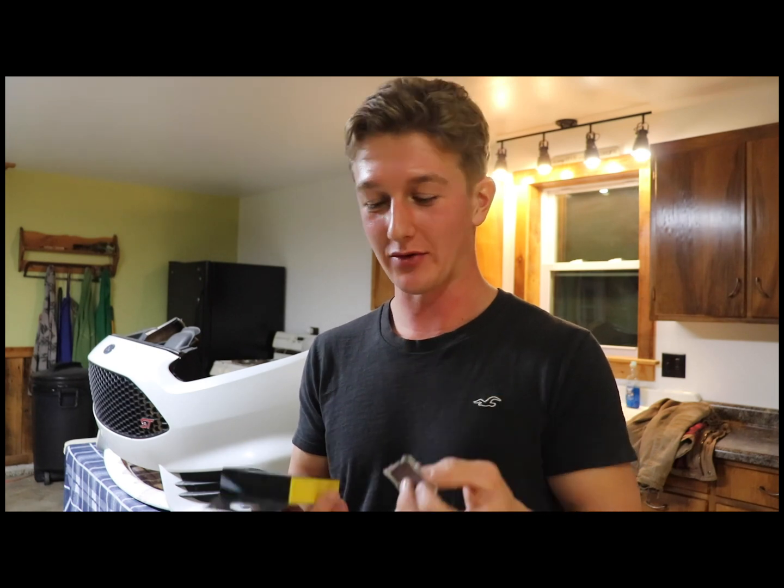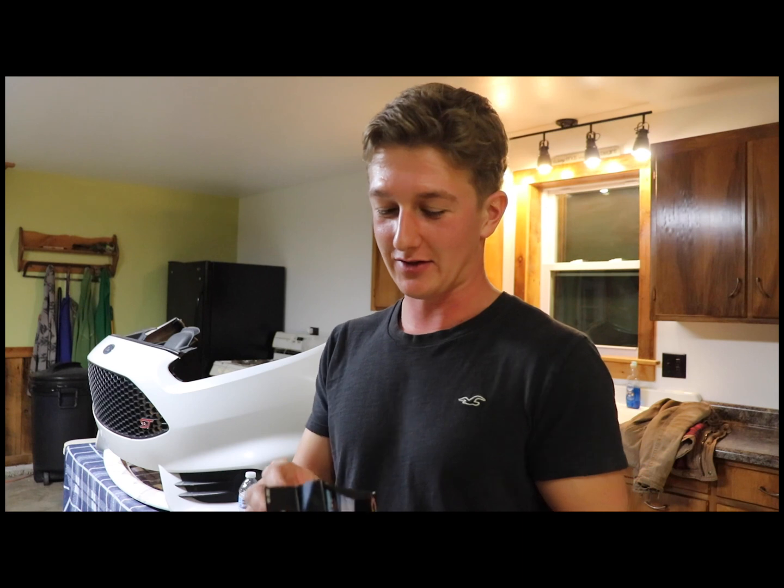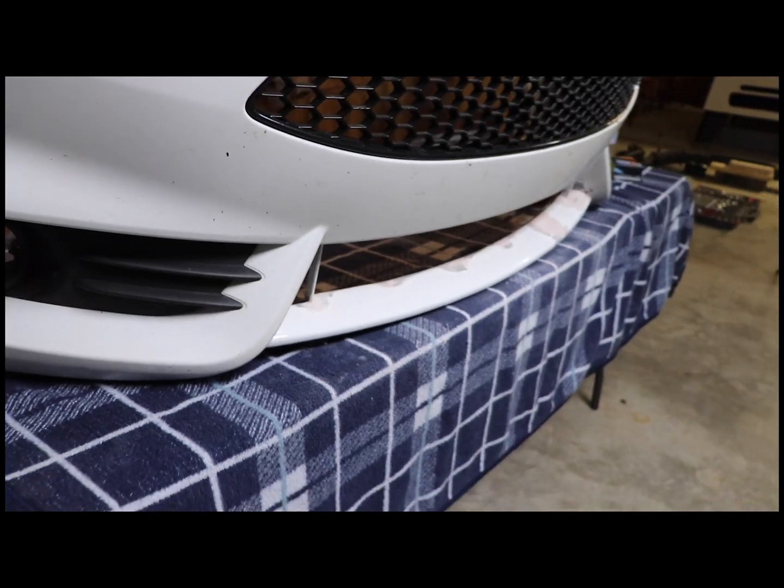This is basically day 3 of working on this thing. It's taking much longer than I thought. But anyway, I did sand it down with some 80 grit sandpaper, and then I have some 320 here to finish it up. I was pretty worried last night actually when I finished up putting the Bondo on there, because it really looked like crap, but after sanding it down, I think it's gonna be okay. I'm just gonna put primer on it next, and then sand it down one more time.